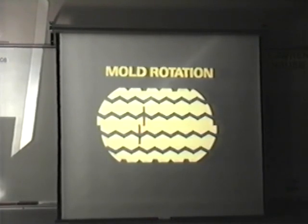But see where those two red lines are there? They should be actually lined right up. But the pattern has been twisted slightly. So a slight mold rotation, yes, you can spot that. That is one way to tell two tires that came with the same design and size that came from adjacent molds or what have you.